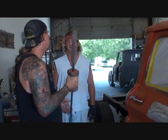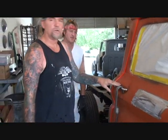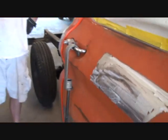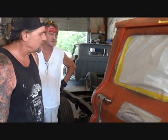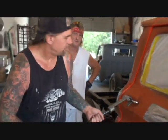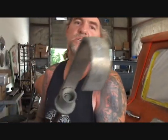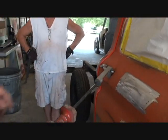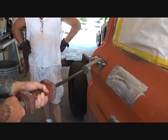Let me explain — you see what this is? This is a big gigantic slide hammer. Now we already know the owner's gonna replace these door handles, so why shouldn't we take advantage of that? Back it up, Dylan. Why don't we take advantage of that to pull this dent out and use the door handle as our anchor? We're gonna take our big giant dent puller — it's got a hook on the end — and bring it over here on this corner. I'm gonna pull this way because I want to pull this corner out.